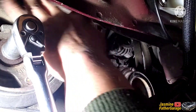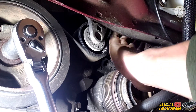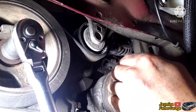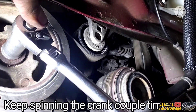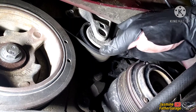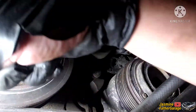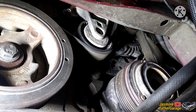Keep turning it and make sure everything is seated right — double check your angles. Alternator — it's on the groove. AC — it's on the groove. Crank and your tensioner. There you go guys, that's how you install that belt, nice and easy. Go around the alternator, the AC, the tensioner, and then the last part is the crank — just turn the crank bolt over. That's it!